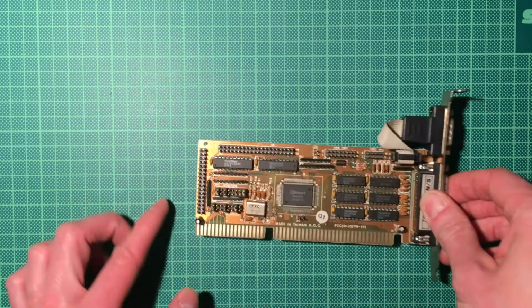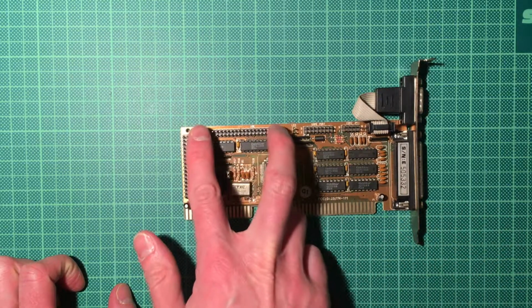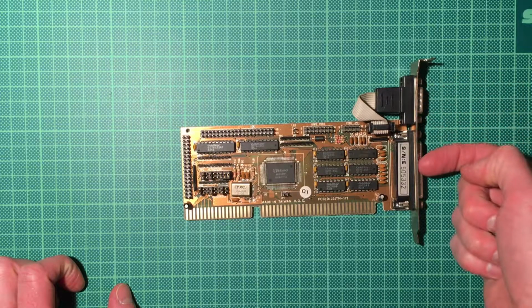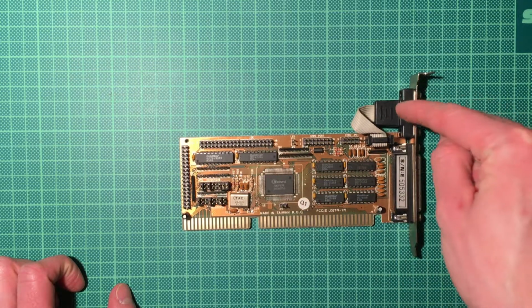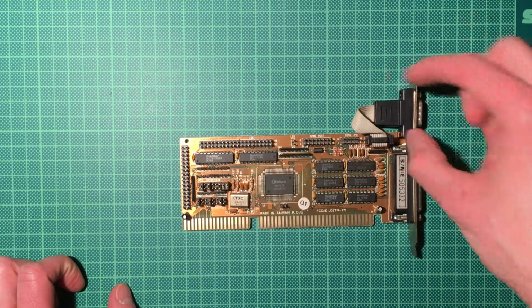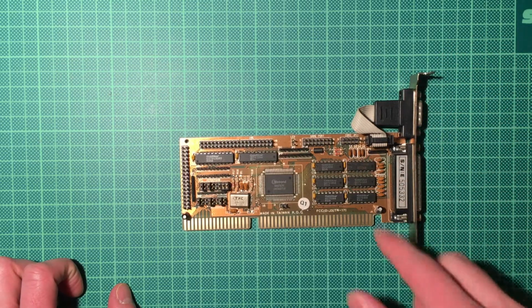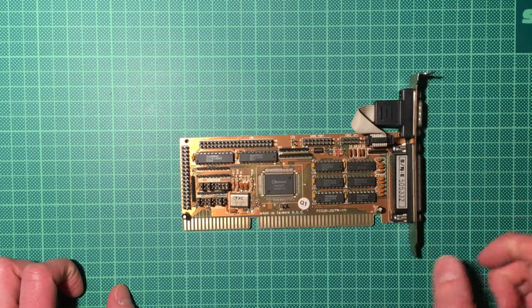And we need to have some kind of mass storage medium. So this is an actual IDE disk controller, which lets you attach hard disks to this port here. There's also a game port for attaching joysticks. Also on the back plane here is one, I think, parallel port, I would say, and a serial port, 9-pin, because we didn't have USB back then. We had serial ports and parallel ports. And there's also a jumper for a second serial port that you could install on a second blade.